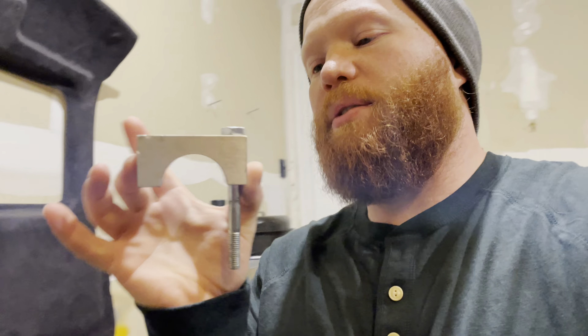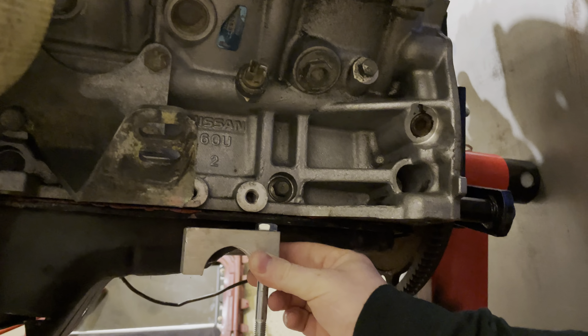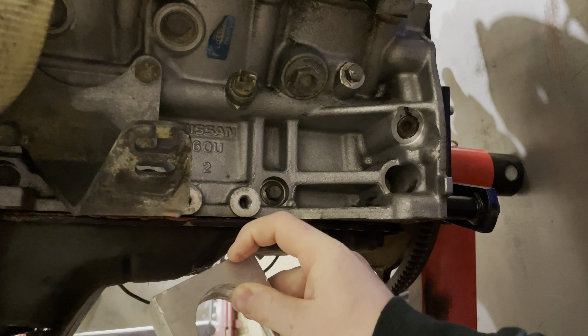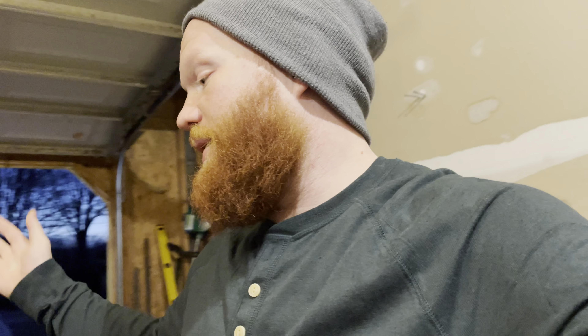This thing is essentially where you saw it last — not too much is done. I do need to modify these rack mounts because what happens, as you can see here, is because these rack mounts are on top, they actually will hit this oil pan. Essentially all I need to do is notch out this section so that the bolt drops lower, run some shorter bolts, and I should be good. That's going to be coming up in a video, probably the same video as the oil pan mods, because those are all things I've got to test fit back in the bay.